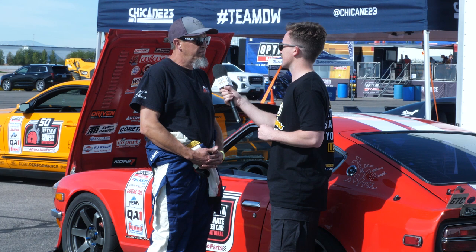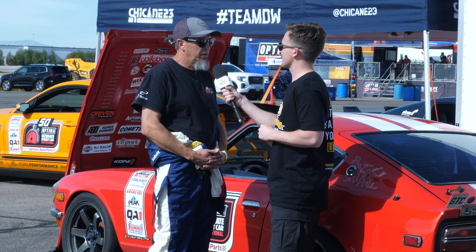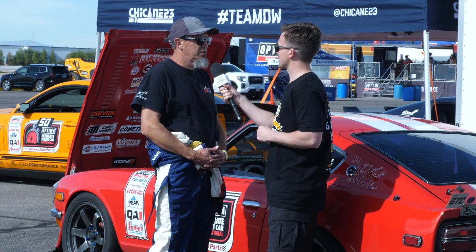That seems like a really effective solution for classic vehicles looking for ABS. Yes, and the other challenges are just finding the reluctor rings and attaching them to your hubs. It was pretty simple on this car because the Zs, if you retain the original hubs, have an overhang that's basically just a dust cover. We were able to lightly machine those, found reluctor rings from reluctorrings.com in Europe, figured out the sizing, heated and shrunk them on with Loctite, and we're good to go.